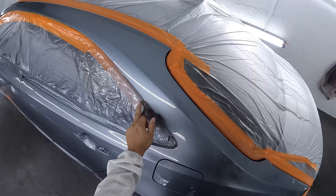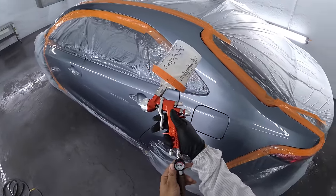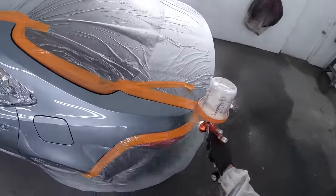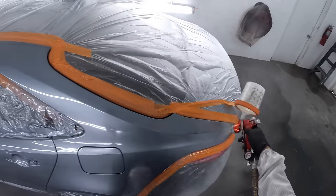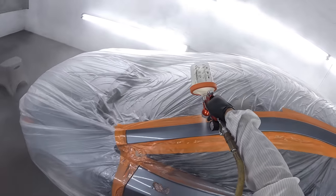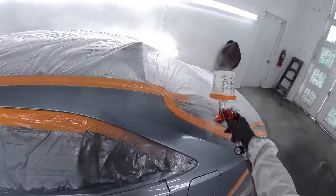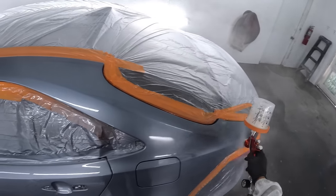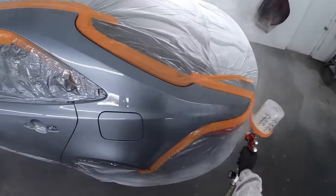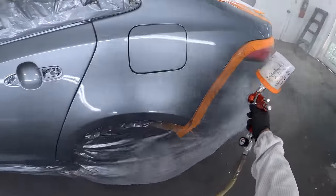Check it — make sure your first coat is tacked off. Make sure it's tacked off good. At 28 PSI, that will help with covering little small pieces of dirt. You'll have little pieces of micro dirt nibs in there — real small ones. But when you let that first coat flash off long enough and you go to put your second coat on, then you have more of a chance to bury it, as well as not getting a run. More so in this case, it'll cover those little small micro pieces of dirt.